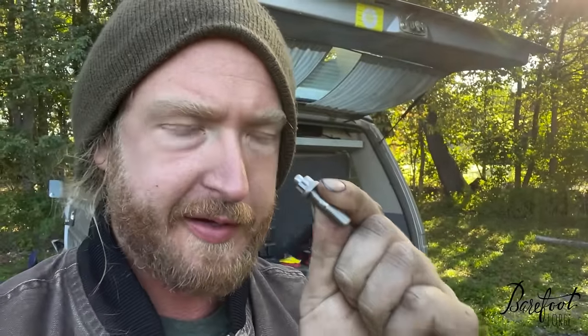Now, we're going to put some studs in the engine. We are installing these ARP studs. I get these on Amazon. I'll post the link. It's like $100 worth of exhaust studs to do studs all around. They're very expensive, but they are a super premium product. We install these with plenty of anti-seize, and these are absolutely going to come out when you need them to, and not break and not corrode. This is the best solution to the Vanagon exhaust problem.